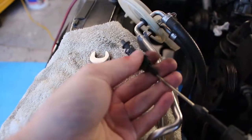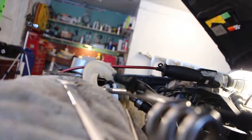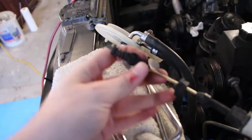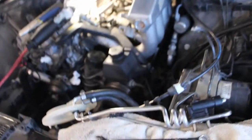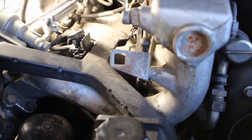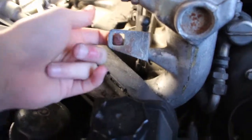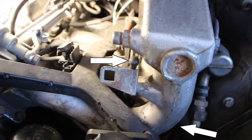The little plastic clip just slides off. Once it's off, it's really easy to move the cable out, and then to pass it through the eye, you have to have the clip off the end so you can pass it through diagonally and remove the cable. You also need to remove both connecting rods from the cruise control linkage — you can just pry those out; they are little ball and nipple connectors.